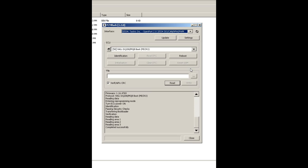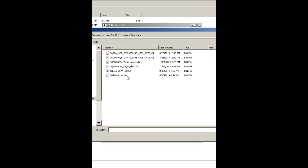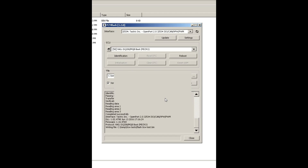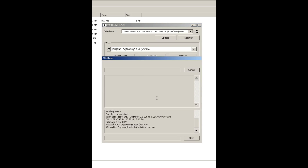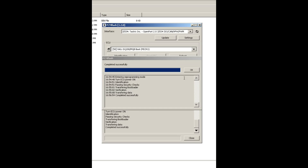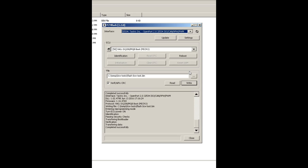Now when we want to program another unit we just flash this information into the new unit. Let's say we change the unit and I want to make a clone. I choose the correct micro flash option, select the cloning operation — you don't need to check 'Verify CRC' — select Write, confirm checksums are correct, no power line control, turn it on, then turn the power off. Done — you have cloned your 0CW unit.